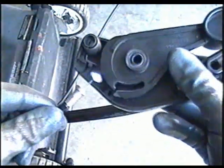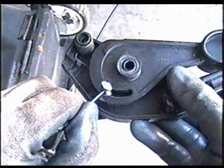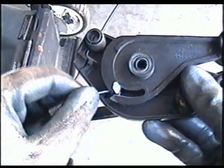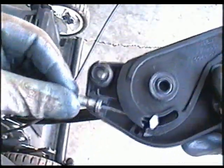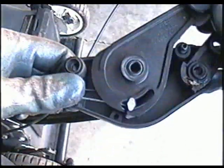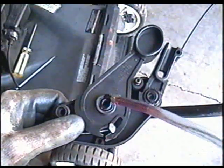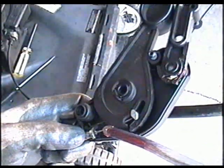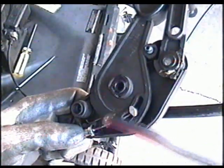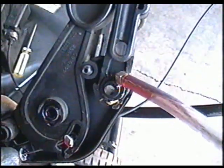Now when you're putting the cable back in, just grab this end here, insert it into the hole like this, and then put the cable down in its socket there. So that's how it goes. You can also take advantage and lubricate the lever in there, add a bit of oil down in your cable again if you want to, and lubricate this lever here as well.